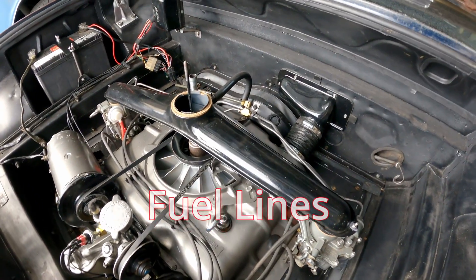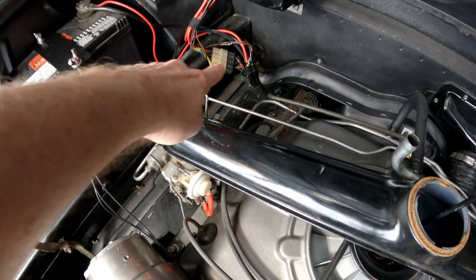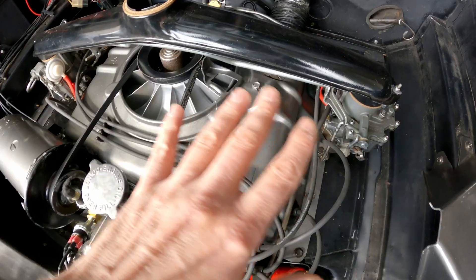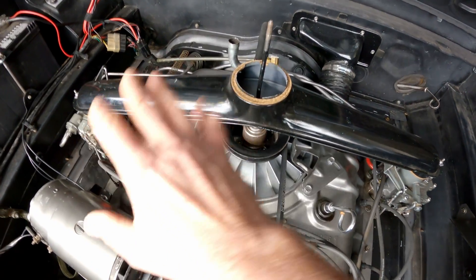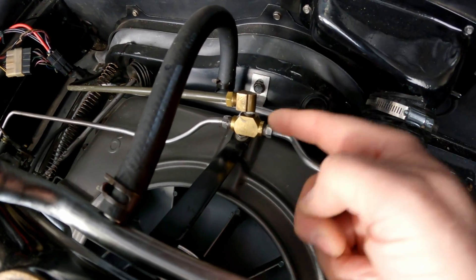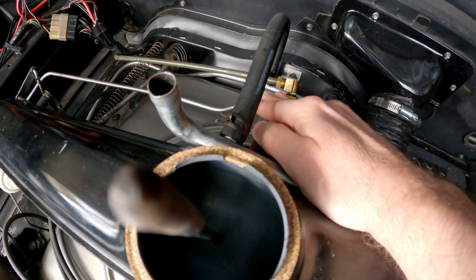The next piece is what to do with your existing fuel lines going to the carburetors. I've removed the air filter assembly so you can get a better look. Originally the fuel line comes in from the firewall, feeds the fuel pump, then branches off to each carb. Since these carbs are symmetrical — just flipped in their application — once you remove all the fuel lines, you can reuse the carburetor fuel lines and the T fitting. Just swap the lines carb to carb: left goes to right, right goes to left, and when you invert them they land right back at the T location at the rear of the motor.